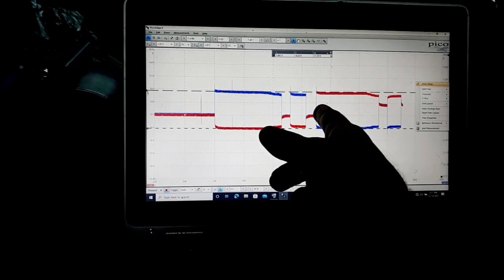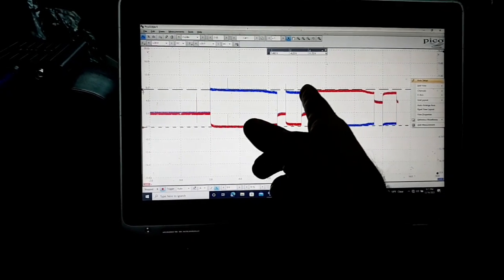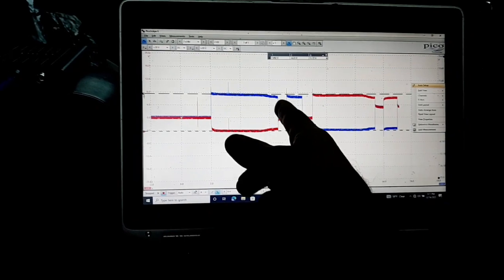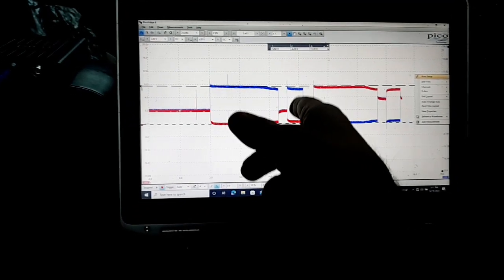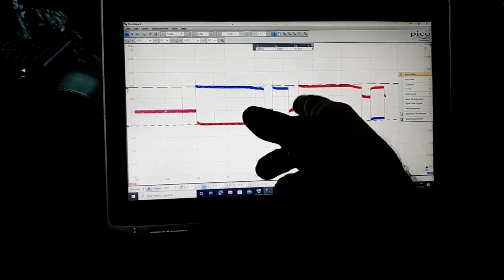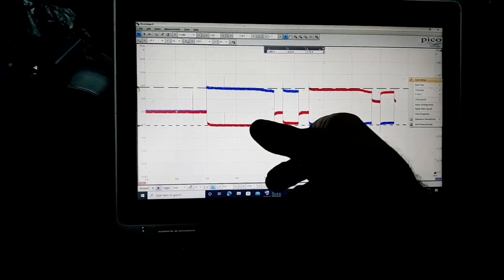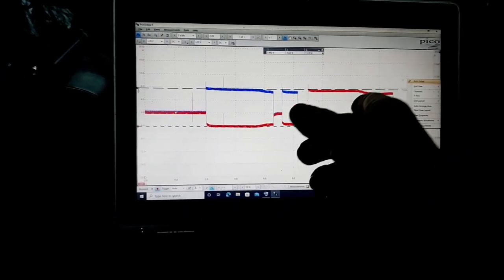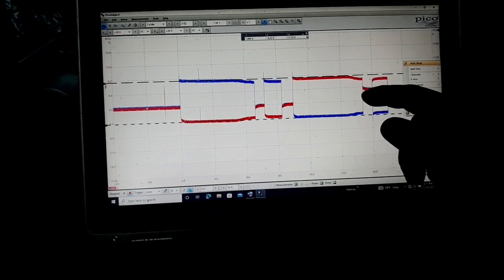This is that pause gap where it's not really doing anything. I don't know, the computer's switching the transistors to reverse the polarity or something right here. I'm not sure. The computer's doing something here. And then this is when the door starts moving in the opposite direction to go to the closed position. And you can see they both start at the same time. This one's the power, this one's the ground. And then right here is when it gets to the closed position.